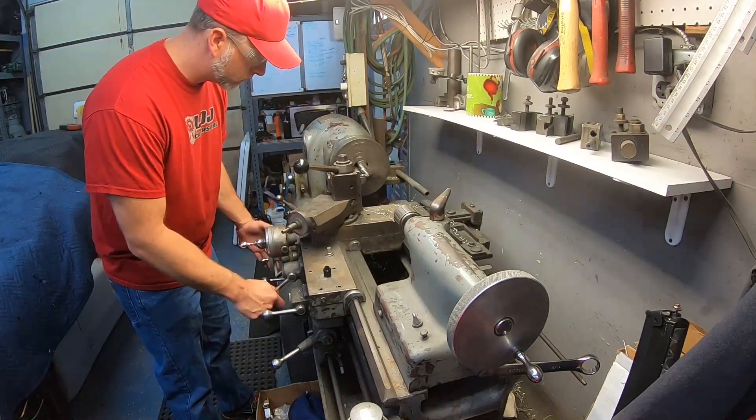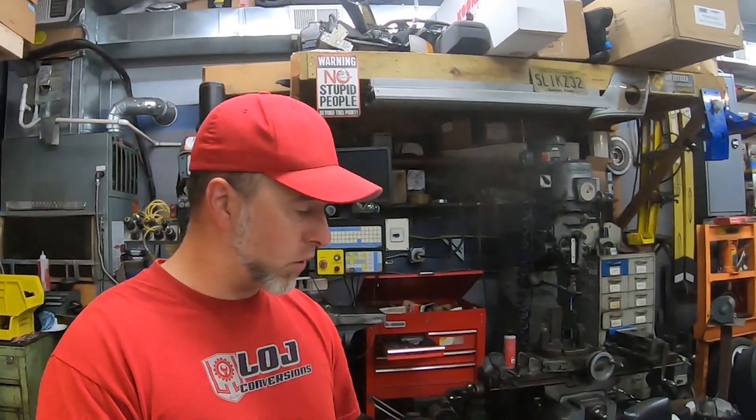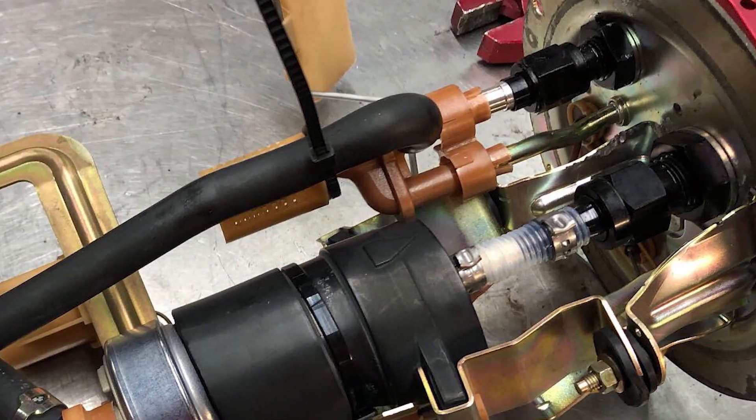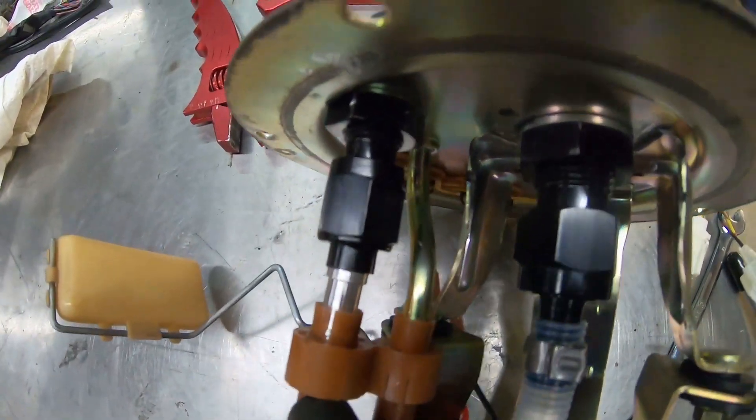What I need to do now is on the lathe, turn down a tube that will connect to the bottom of that dash six return, then step down slightly to the correct size that will clip into the factory Venturi pump so we can still pull fuel from the other side of the saddle. I'll be using aluminum tubing and I will drill the ID to be the same size as the ID of the tube that we cut off the inside of the sending unit. The OD at the bottom will be the same size as what needs to clip into the Venturi pump. On the top side, I'm going to mimic the outside diameter of an AN hard line, machine a little flare into it, and use an AN tube nut to hold the tube onto the bottom of that bulkhead fitting.